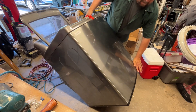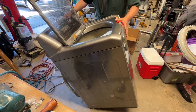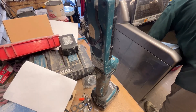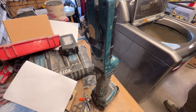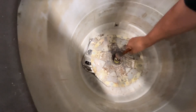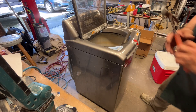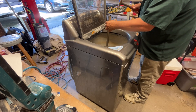So I had to flip it back over and pound the shaft out from the plate. The plate is still attached to the clutch assembly. I tried not to hit it too hard, just trying to loosen it up. I had to put the camera down to get down in there and give it a good whack. I needed a pipe to get down in there and hit the center of it — I just couldn't get a good swing with the mallet. So I used a solid piece of aluminum rod I had laying around and was able to pop it through.